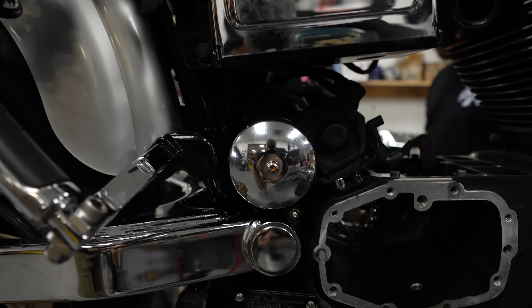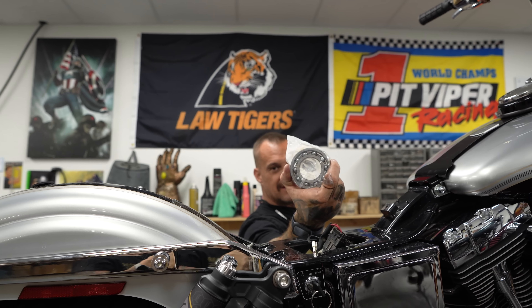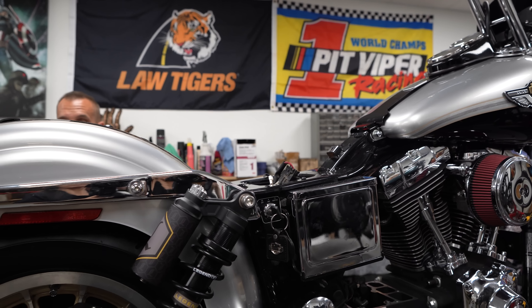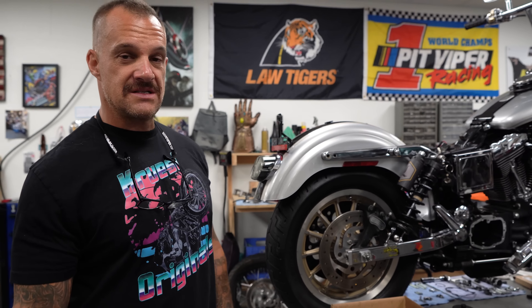We had a plastic cage bearing — we're replacing it with a steel cage bearing so that will never happen again. That thing still ran and worked perfectly fine and didn't make any noise, which was absolutely insane to me. I just pulled the seal out to reseal the transmission — I wanted to reseal everything and make it fresh — and when I popped the seal out the bearings just fell down to the bottom. It was like, wow.